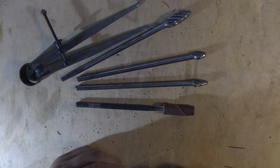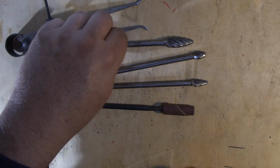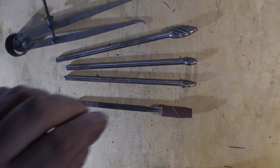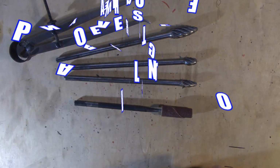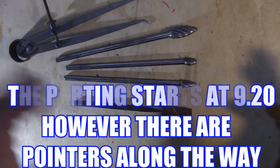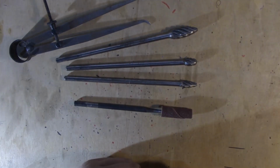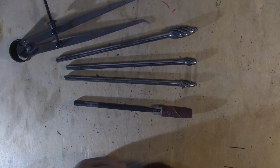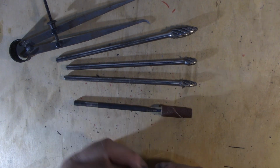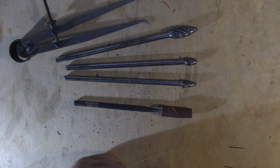And then you can get crazy with the aftermarket blocks like the Robert Ponds and the Bear motors and 427 Garage and all those. Those are your high-end. If I buy one of those, I'd probably go aluminum. But that's your high-end stuff, that's your race stuff. This is just a good cruiser, good all-around truck. So, Edelbrock heads on a 390 are great for the street. They're great for a lot of high-performance racing applications.